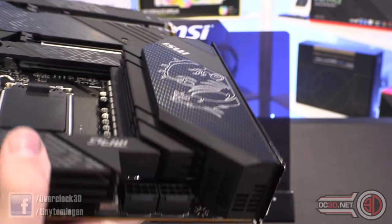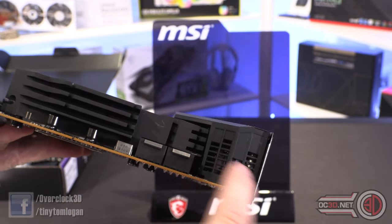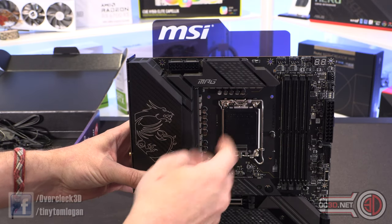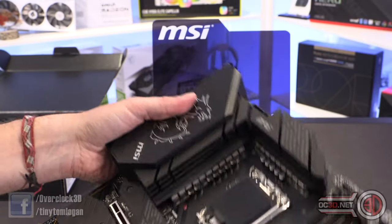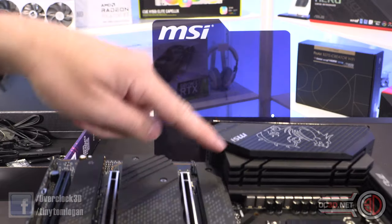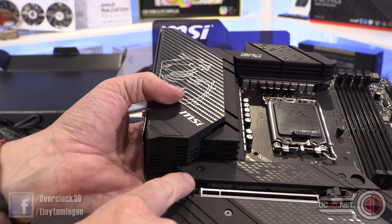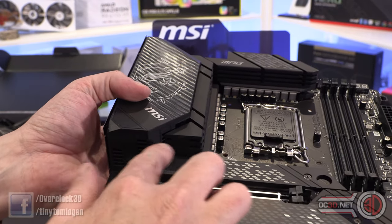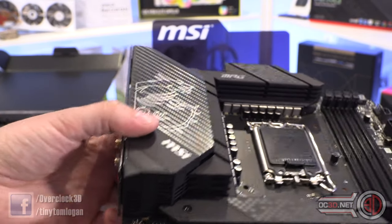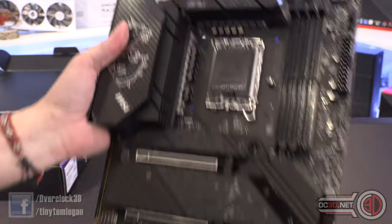All of these things make me wonder whether the VRMs might get hot. They've even put vents in at the top here, so when your board is built, the heat from underneath can ventilate outwards. But this is a plastic top covering it up. On a lot of graphics cards there'll be a little vent that's meant to blow out, so you might inadvertently get GPU heat coming up through those vents there. I'm not sure that's such a good idea, but we'll see.